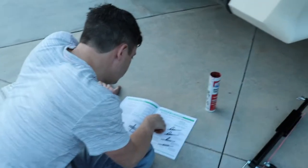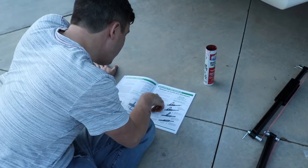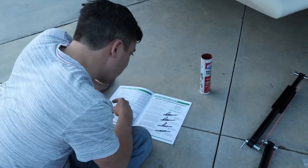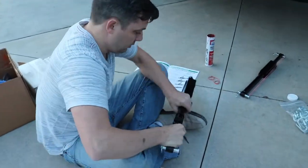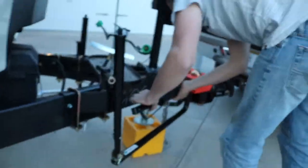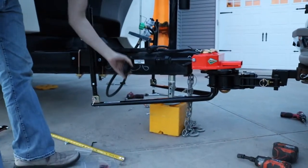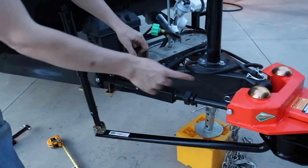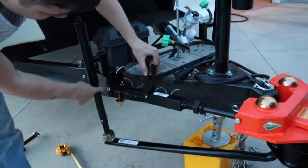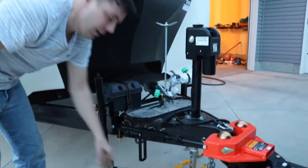The struts are one of the most important components of the Hensley — failing to install or adjust them properly may impede the system. Raise the handle and slide the locking sleeve back to reveal the square strut nut. Adjust the nut toward the locking sleeve post as far as the thread will lock. You want this to be further away from the main hitch and parallel with your frame. There are three different holes — to make ours parallel with the frame you want the center one.